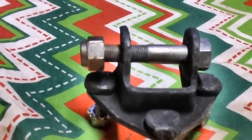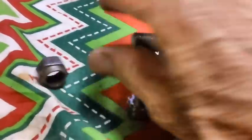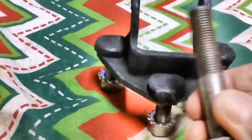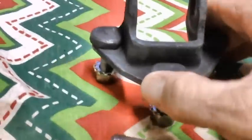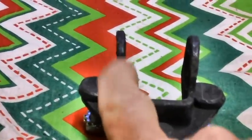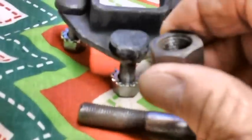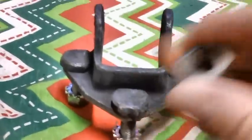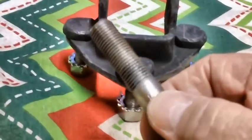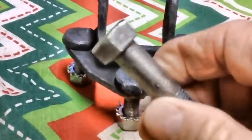We're going to start over again on the passenger side. Unfortunately, these two items cannot be used. The bolt is indeed hardened steel — it has to be a hardened bolt because that shock is thudding all the time every time it hits a bump, and you've got a lot of weight on that thing. You can see this is kind of bent, so I'll have to flatten that out. The threads were rusty inside — there's just not enough left for a good measure of safety to hang onto the bottom of that shock.